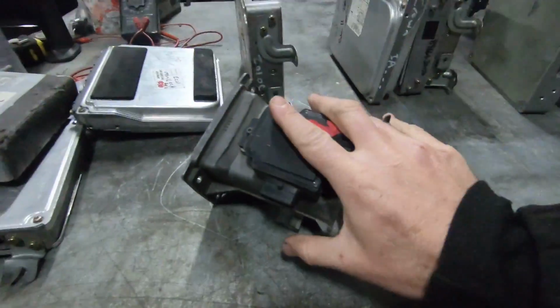All the ECUs just there, so the 141 Crown Majesta, the Soarer, the early ones with the 40-40-40, and the UCF10 and the Crown, they're all running on that early airflow meter. All of those engines, when they came out of the factory, have the left-hand coil, sitting in the vehicle, left-hand coil, the tower's pointing up on all of them. I haven't seen that rule broken yet. So that might actually be a rule.